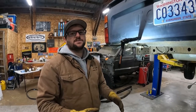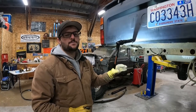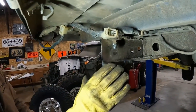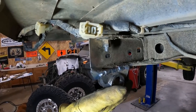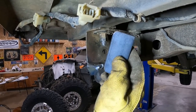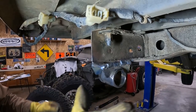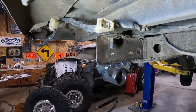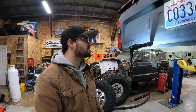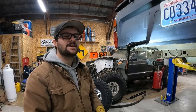So we're working on getting the rest of the brackets finish welded for the 63 swap, and right now we're working on the back portion. We have the brackets completely welded, but the back of the frame here is not very well supported — it has the ability to rotate if it's not braced. So what I did is I cut a couple pieces — just some scrap steel I had laying around — and we're going to put these in the end here and weld them up, and that will help support it and keep it from wanting to rotate. The bumper on this is pretty beefy, so that'll tie it all together side to side. So we're going to go ahead and weld these on, and then we'll be completely done with all the welding for the 63 swap, and we're going to move on to cleaning and painting.